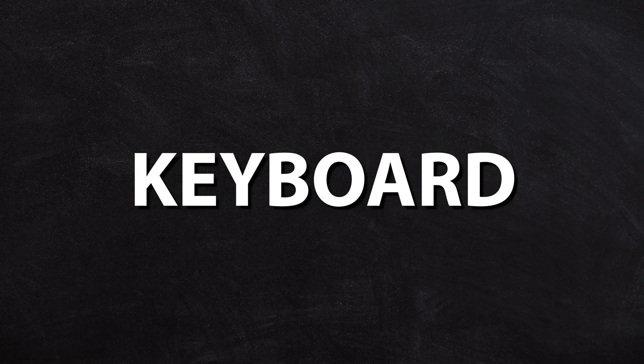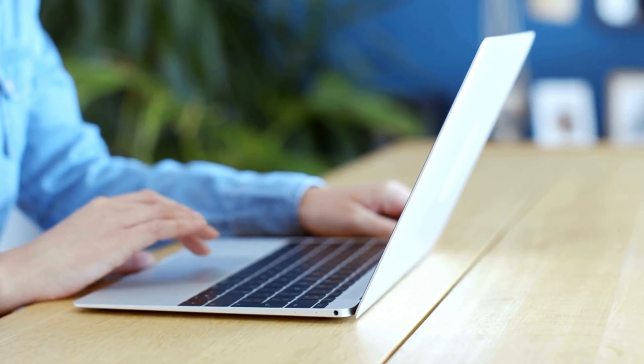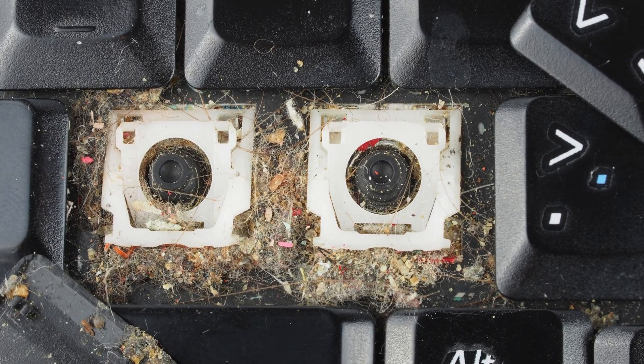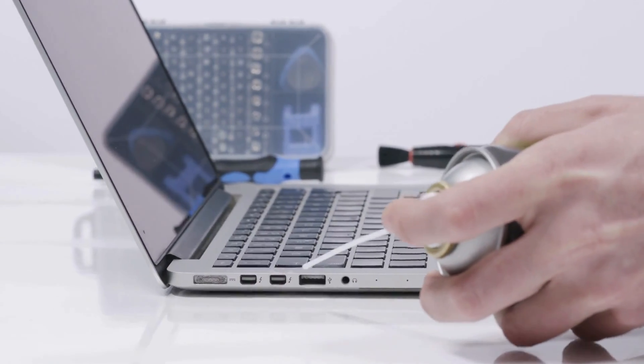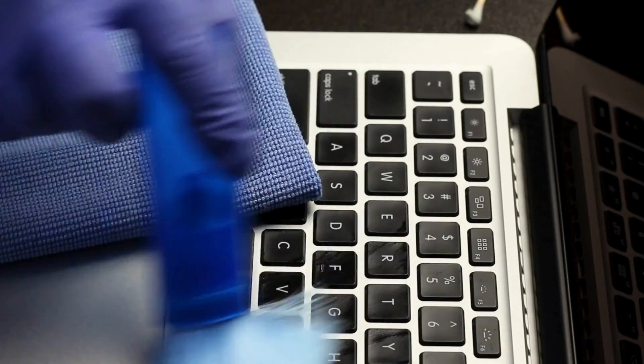While we're talking about keyboard, we'll move on to our final issue, number six. If you've got an issue with the keyboard or the trackpad, quite often it can be debris or something spilt on there, causing it to not properly sense touches from your fingers. My recommendation is to first give it a thorough clean. For the keyboard, crumbs and small bits of dust and grit can get under the actual keys — technically you want to use a compressed air can to clean this out, but if you don't have one, you can blow on it, use a soft brush, or even a soft toothbrush to clean underneath the keys. Holding the laptop upside down and pressing the keys a couple of times can also help get debris out.